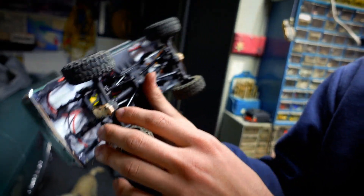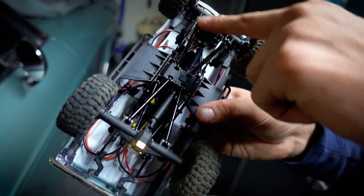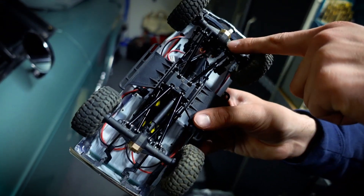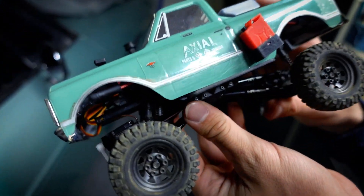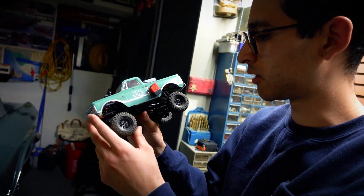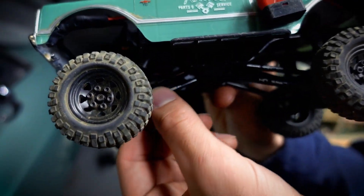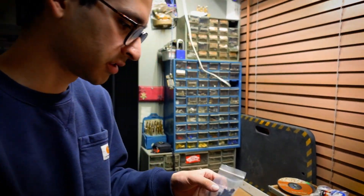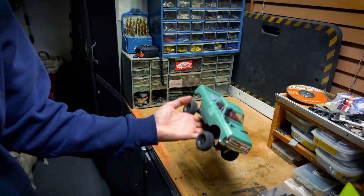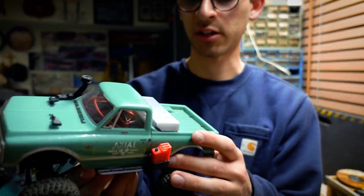I would definitely install the links at the skid plate first, then at the axle - once they're at the axle they're hard to move around. Overall this mod is about $30, and next time I'll probably think twice about something at that price point. There's not really a performance upgrade with these links - they're just for durability compared to plastic ones that will snap in colder areas. Don't throw away your old parts - always save them in case you need them in the future. That's how you install the links - thanks for watching and subscribing, I'll see you on the next video.